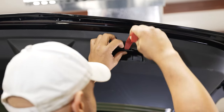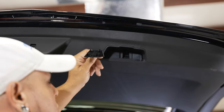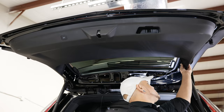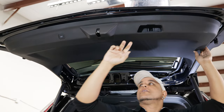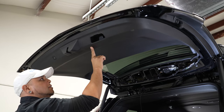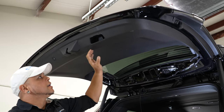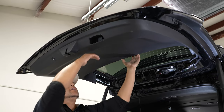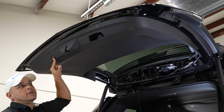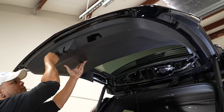I'm going to pull this handle cover piece off — in the center here is a little plastic cover hiding a 7mm screw in there. We need to pull that out. The next thing is basically yanking the whole panel off. On these liftgate pieces, there are clips going up and back. I like to start on the top side, popping all the clips loose, and then once I get to this area here, pop it down and out at the same time. Keep in mind you have a button here with a connector on the back, so once you release the whole panel, it's still going to be attached — you'll have to unplug this to release it.